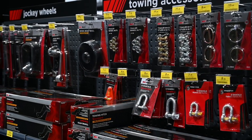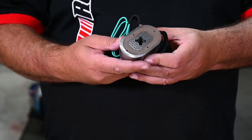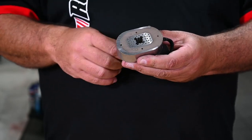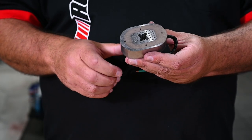The other part of the braking system is the magnets inside the hubs. There are two easy checks you can do. Firstly, get a straight edge and put it over the contact surface of the magnet itself — you're looking for any pitting or unusual wear on the contact surface of the brake magnet.